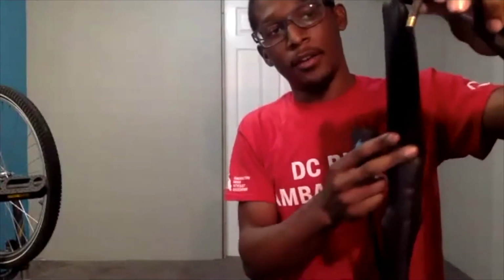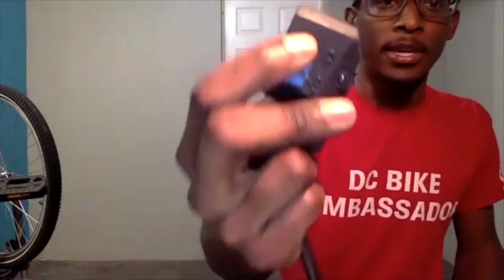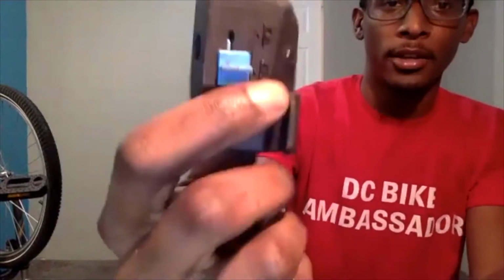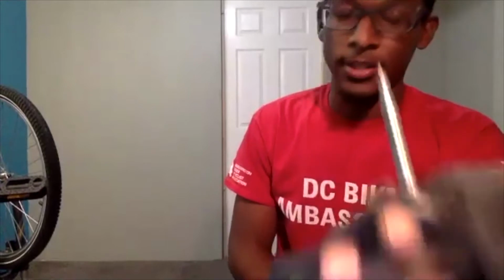So Schraders are generally your standard valves for tires, similar to those on cars. Most cars have Schrader valves as well, but others have P, which is short for Presta valve. So again, you have Schrader and you have P. And to identify the type of valve that you have, I find it easier just to remember that the bigger opening, which is the S, is Schrader, and the smaller one, when you switch it, has a smaller opening. I don't know how easy it is to see there, but it has a very small opening. And this is what a Presta valve looks like.